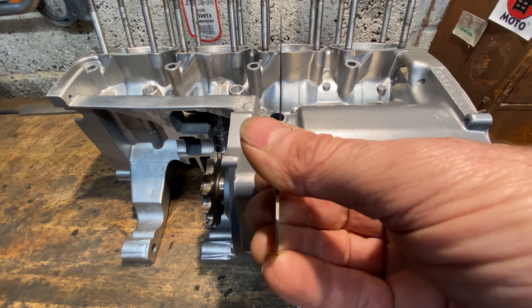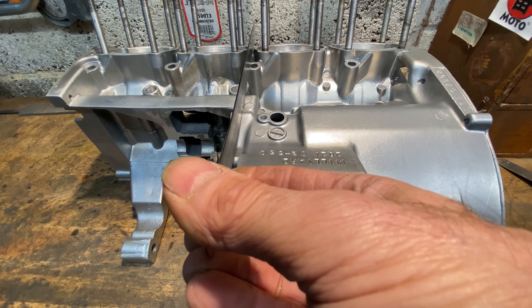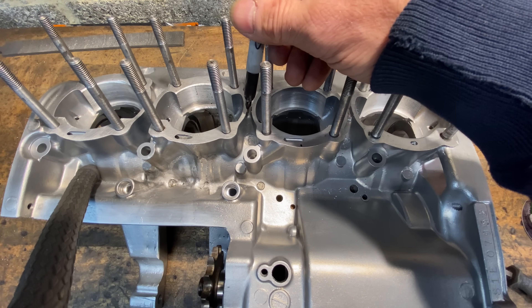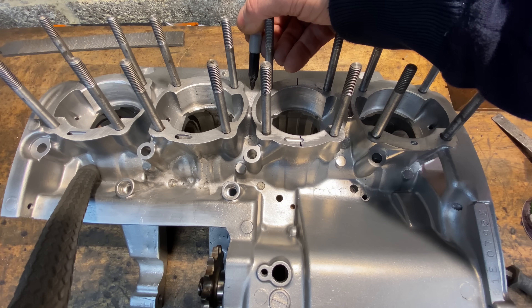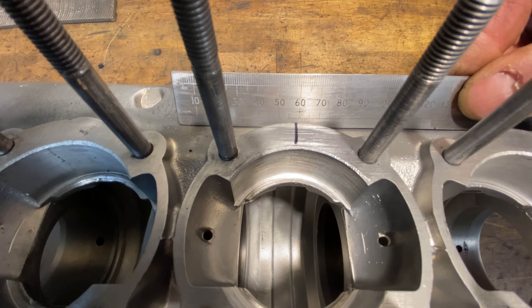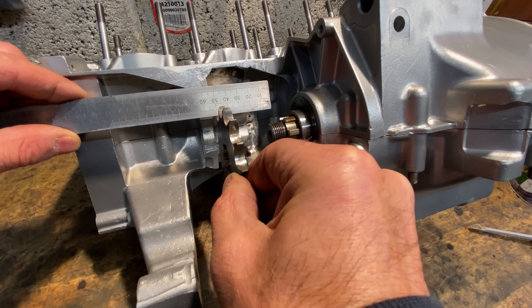The original centre line of the three-cylinder engine was in the middle of cylinder number two, but now it's between cylinders number two and three. I make two marks — one in the centre of cylinder number three and one between cylinders number two and three — and measure that distance. This is the offset I need to put into the sprocket. I measure it with my steel rule and it's 48 millimetres, so the sprocket needs to be moved across 48 millimetres.